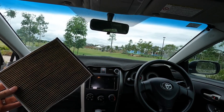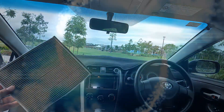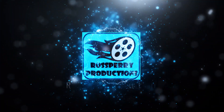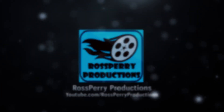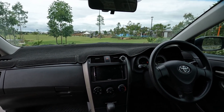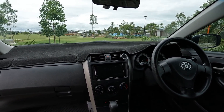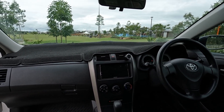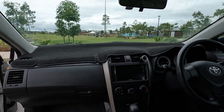Welcome to another Ross Perry Productions video. In this video I'm sat in a 2008 Toyota Corolla and I'm going to be showing you how to remove and replace your pollen air conditioning filter, which is actually found right behind the glove box. It's a nice simple job — you're not going to need any tools for this, just your hands.